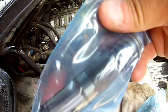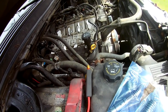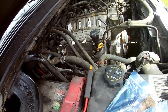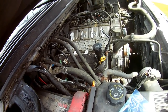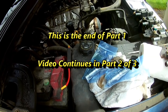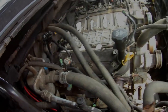These are the new lifters — I got two for cylinder four and I'm going to do them both. I could have done the other two as well but it's an old engine and I don't want to spend a ton of money on it. They're only about $50 each. Realistically it would have been better to do all the lifters, but that would include a whole other head, another head gasket, and all the associated labor. I'm going to fill these little bags with oil to let the lifters soak while we finish the rest — I want oil penetrated within the mechanism.